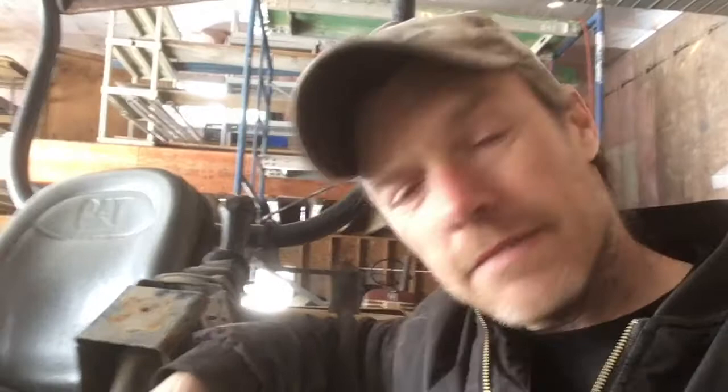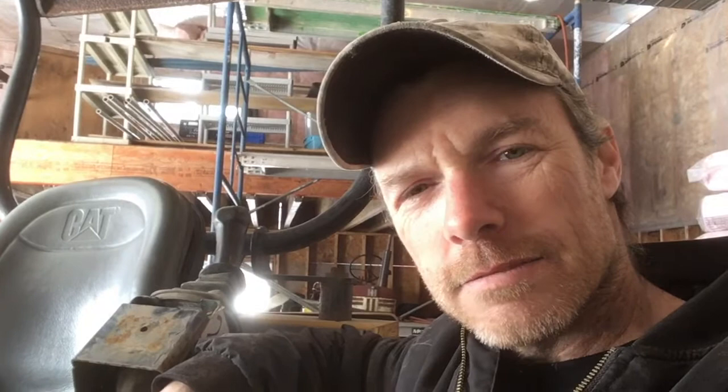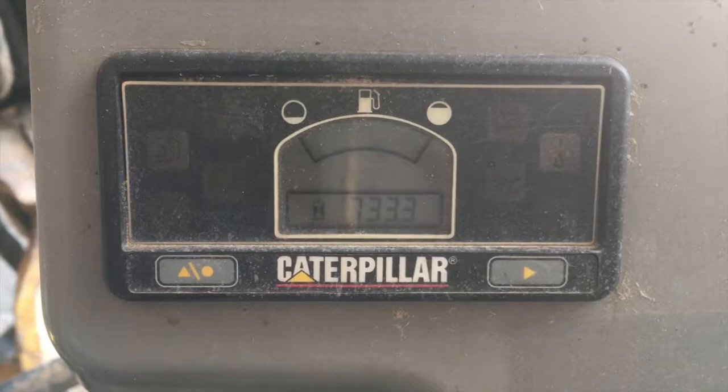I'm sure that is the problem. So I'm going to take that safety switch out and I'm going to put it on a manual toggle. It'd be a really good anti-theft switch, so I'm going to tuck the toggle switch just out of sight. But I'll show you what it does when she won't start — I'm going to let the glow plugs run. And when we head back here to start it, she won't start. By jumping the relay, she starts. So it's not a solenoid problem on the starter.